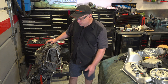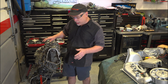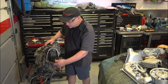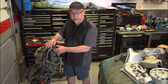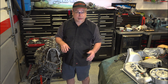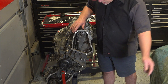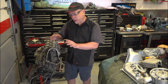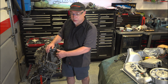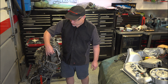Now we're going to line up the intermediate shaft with the cam sprockets. I made a video on this before but I'm going to try to make it a little easier to understand. Basically what you do is measure the face of the cam sprocket here, measure the face of the cam sprocket on the other side, compare the two measurements, and then use shims — which by the way are also the alternator shims, so a five-pack works for both. It's really not recommended to put the chain on before you do this because you'll just have to fight pulling it back off.